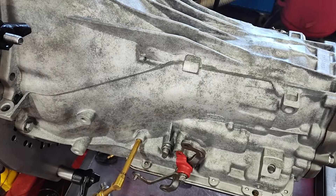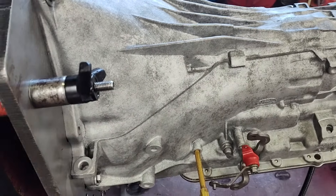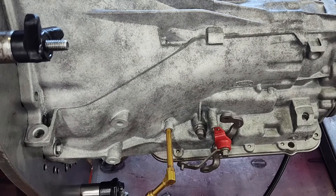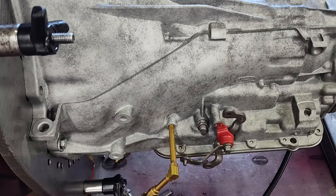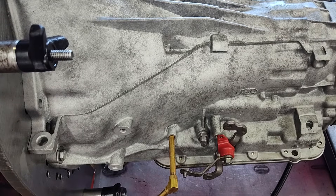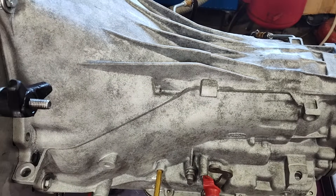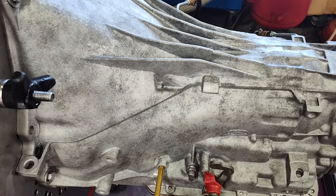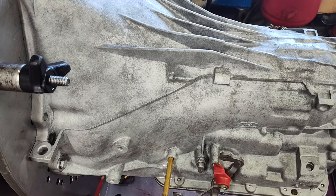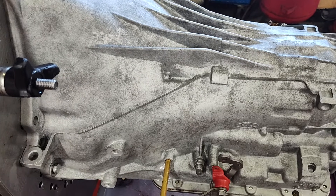Let me try to show you here. I'm going to fire this up, and what I'm going to do is move the shifter through the gears with the vacuum connected — that lowers the pressure. Then I'm going to run it with no vacuum, where the pressure goes up, which will simulate a manual valve body and higher pressures, and you're hopefully going to see that I'm struggling to move this shifter.